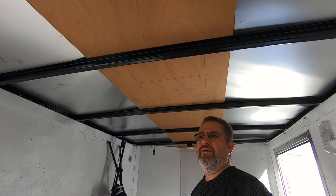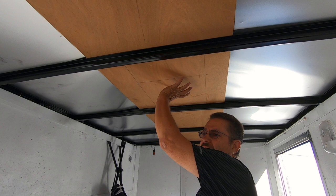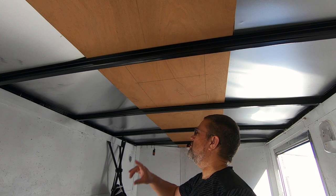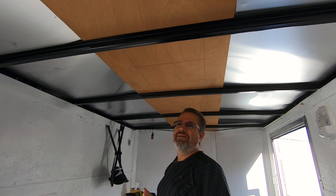Today's mission is to get my ceiling fan put in. The first thing I'm going to do is drill my pilot holes so I can cut from the top in. I'm going to drill four pilot holes from the inside going up. I've got my 14 by 14 hole — the fan is going to go right here. This is the part I dread — drilling the four holes, making sure I've got the right spots. No turning back now.